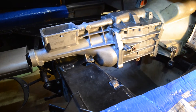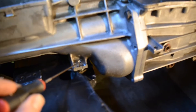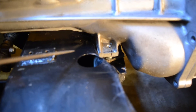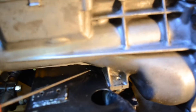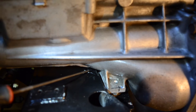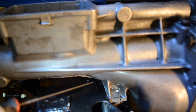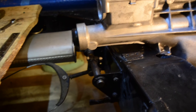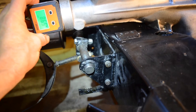I've got the T5 test fit into the chassis now. I mounted the mount by drilling and threading the holes in this rear support. I have a fair amount of clearance to the chassis — it looks like about a quarter of an inch — so I'm pleased about that. I did have to take off a little bit more on this rear area; I took out a little bird's mouth out of the box section just in case it sags or I need to go a little bit lower. I still have to phase the driveline, which is getting the pinion angle of the differential the same as the output angle.